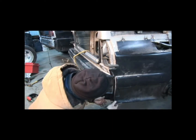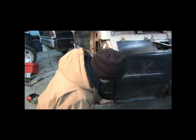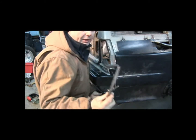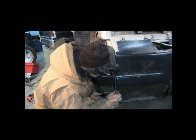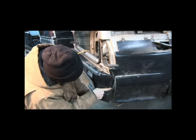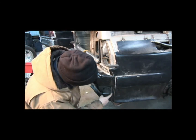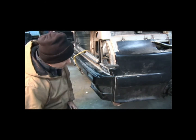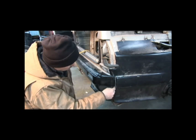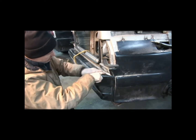Check this out — if I bring it underneath here where this is at the very base at the top part and you look down here, in order to bring this flat the way a regular bumper should. We've got the handy dandy scribe right here so we're putting it flat against there. This is what I'm going off of. If you take a look — look at how much we have to trim off of this thing. Wow, that's crazy. It goes right into here and you can see there's an indentation — it looks like the bumper but they just flared it out. So let me go get the whiz wheel, the air tool, and my respirator, and go zip that out and see if this thing becomes straight.